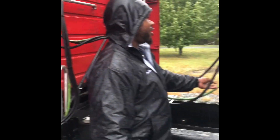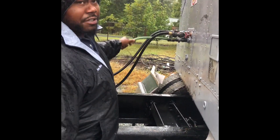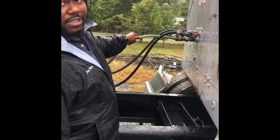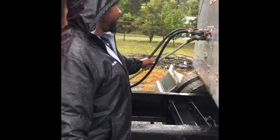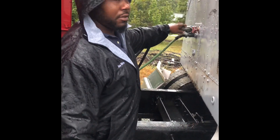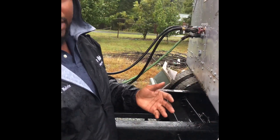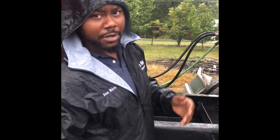Service line, emergency line, electrical cable — properly mounted and secured. He's going to ask you how many pins are inside this one — it's got seven pins. That's the pigtail. When you inspect it, you got to take it off. It has a rubber gasket — he's going to ask you what the name of that is. It's called a grommet.